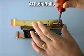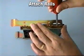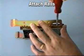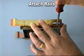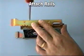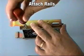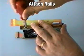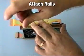Since most hard drives are smaller than the opening in a chassis, your next step is usually to install a series of rails on either side of the drive. This makes the drive wider and allows it to fit snugly into the opening on your chassis. Use screws to secure the rails to both sides of the hard drive and secure the rails snugly, but don't over tighten them.